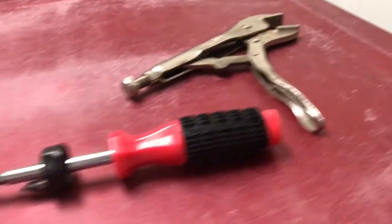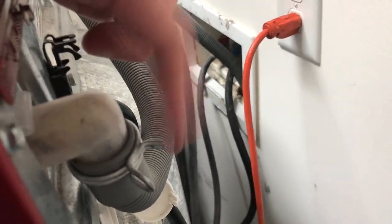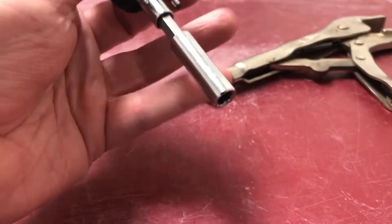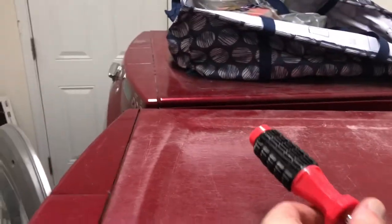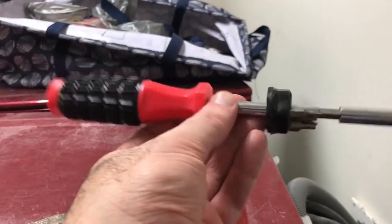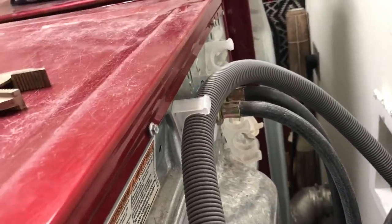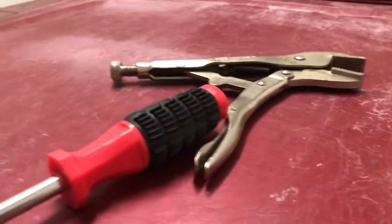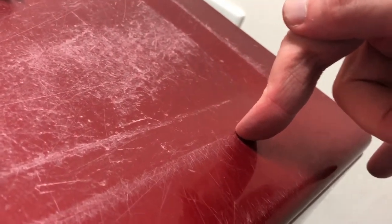You don't want to get underneath the hood. I use vice grips for these adjustable pinch clamp grommets. You're going to have three screws — one, two, and three — to loosen. Once this thing's open, you can literally just grab the back of it and it'll pop right out, and that'll give you access to where the drain hose is.